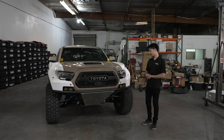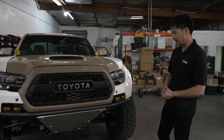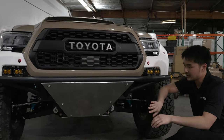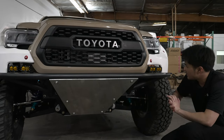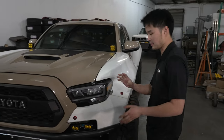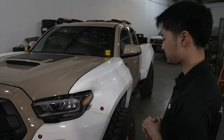We're now at the front of the truck. The pre-runner bumper we made here is all two-inch 120-wall chromoly construction, TIG welded throughout. It's 100% bolt-on — we retained all the factory mounting points and tied it into the lower pivots. It has a quarter-inch aluminum skid plate using all stainless fasteners. We have S2S lights on the front bumper as well as 2020-and-up TRD Pro LED headlights, which are super bright and complement the Baja Designs LEDs really well. On top of the hood we have the racer edition squadrons.